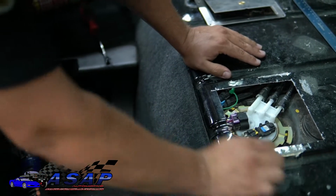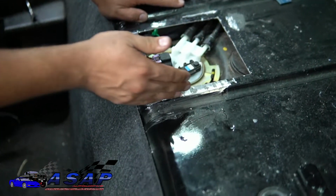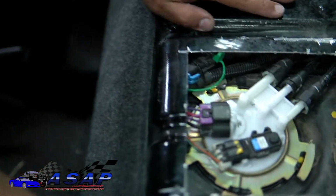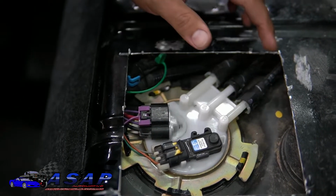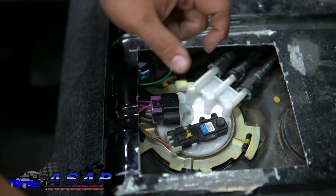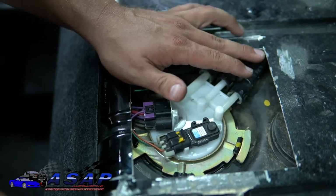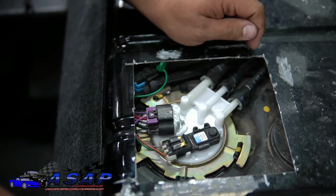One tip, whenever you're cutting this out, I would start up here. Start on the top side, come down the passenger side, and then work your way back down the driver's side. You can see why you don't want to start down here. You've got harnesses pushed up right against here. If you're going to use a Ziz wheel, which is what I did to cut this, go very low and slow, just right before it starts slinging sparks. I had a die grinder with a cutting wheel on it, and I'll show you in a second. I marked down through and worked my way back and forth until it started coming through. Just take your time and be patient. You don't want to drop down and nick into anything here, especially in a fuel system and throwing sparks.